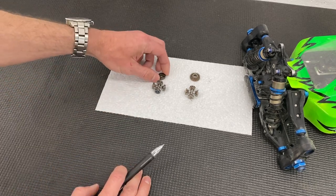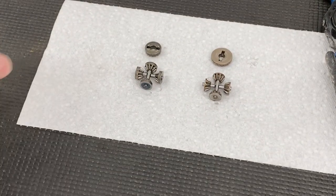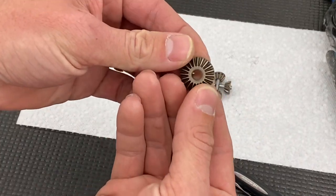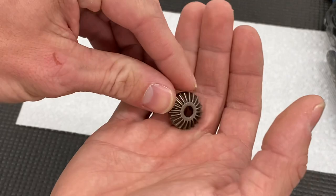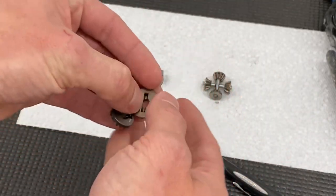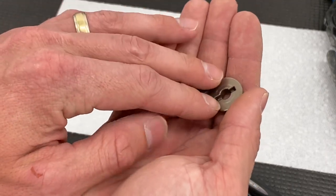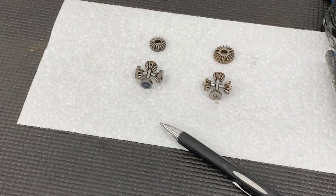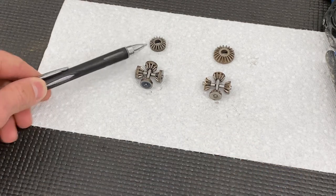Let me show you the difference on the back side — zooming in again. You can see there's a big difference in the amount of material here. This is HTC — it's a much bigger gear. This is LTC. There's a different tooth count and a big difference in size. There's a lot more meat in the HTC diff gear than in the LTC, so keep that in mind if you're going to run it in Truggy — you might want to take it a bit easier with the LTC than you would with HTC.